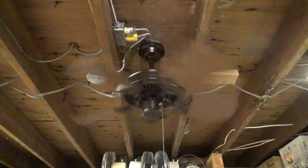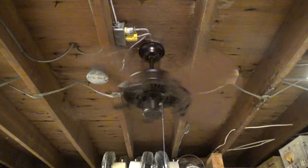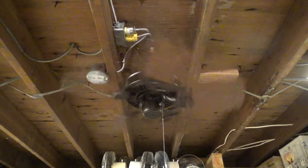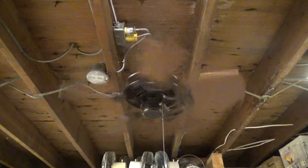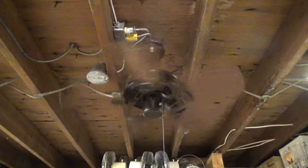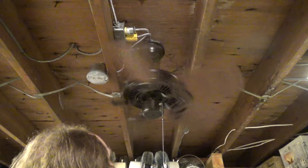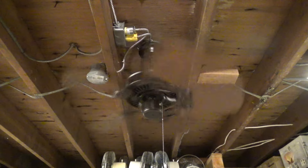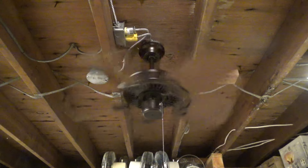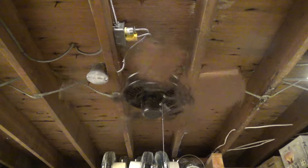It gets up to speed pretty fast. It's a 153 by 10 motor — very small, but it's also a small fan. The air noise is just about non-existent; this is a very, very quiet fan. There's an ever-so-slight hum, and that slight hum is actually more audible than the air noise. Testing power at 118.8 volts, we have 0.36 amps — considerably lower than the claimed 0.5 — at 43 watts with a power factor of 1.